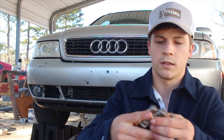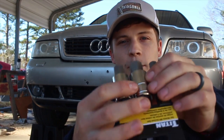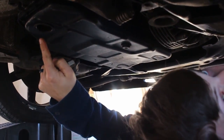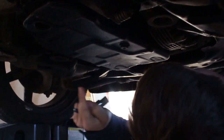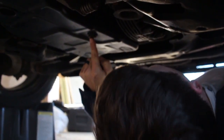See that? It's massive — but that's the drain plug. You can actually get these at AutoZone or O'Reilly's or wherever. We're just going to undo it. I'm going to put fluid in right now; I'm not going to change the gasket and filter — I know that's probably what I should do, but this is a quick fix. So your fill plug is right here and your drain plug is right there.